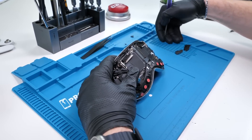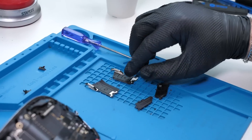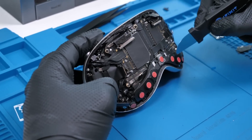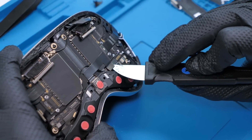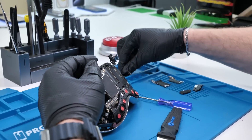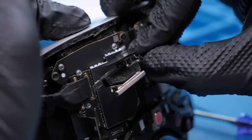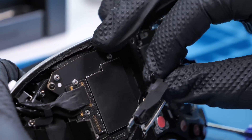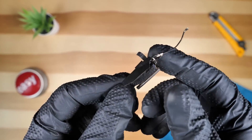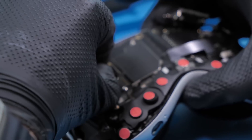Because there are no tutorials or any instructions on how to do this, it's kind of like a little puzzle. With every piece we remove, we get closer to finding out everything about this device. All of the connectors over here seem to be connected to the sensor array, so everything I disconnect probably corresponds to that. This is the LiDAR sensor and this seems to be the dot projector. This is probably your Bluetooth antenna — we can actually go ahead and disconnect these antennas. These are probably the actual display cables — they look a lot like MacBook display cables.